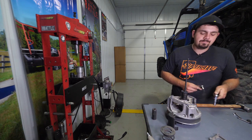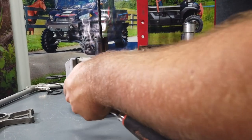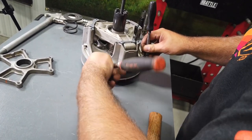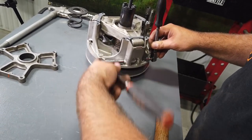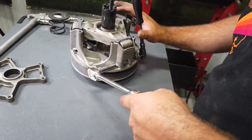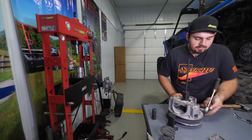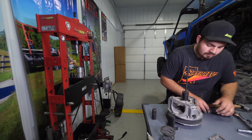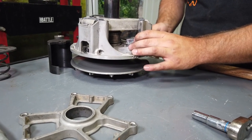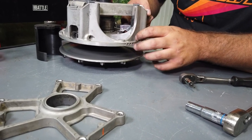This is a crucial part of the installation: tightening the arm bolts. If you over-tighten and pinch the tower down, the arm won't move freely and the clutch won't work properly. Rather than really tightening, just snug the bolt — it's nylock so it won't back off. When it starts giving resistance, go just a quarter turn more, then pull the socket out. The arm should move completely freely; you should be able to wiggle the bolt slightly with an allen wrench. As long as the arm pivots freely on the shoulder bolt, it's tight enough.